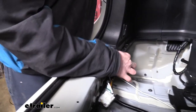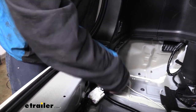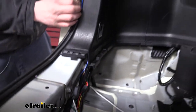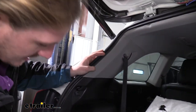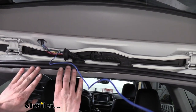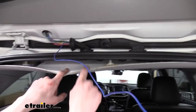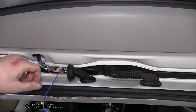We're going to start with one of the wires we didn't route outside — the single small blue wire in your kit, which will be closer to the fuse harness. We just poke it underneath the weather stripping and work it all the way up to the headliner. Once you get to the headliner, you can dig your hands under there and pull it down, pop down a couple of the connectors, and route that blue wire up into the opening where the wires go into the tailgate.